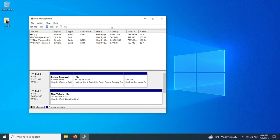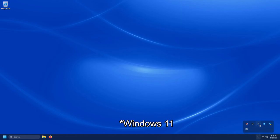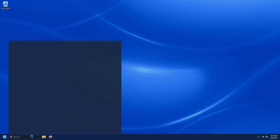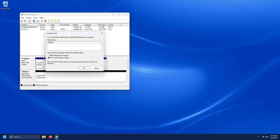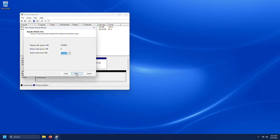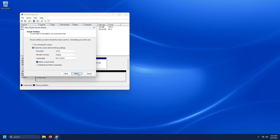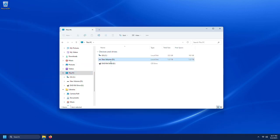The procedure for Windows 11 is very similar — in fact it might be exactly the same, but we'll do it anyway. Drive is spun up, we can see the dock in device manager, same situation as Windows 10. Search for disk management, same deal — it wants to initialize a disk. Say yes, it makes a basic disk, right-click, New Simple Volume, click through the wizard same as before, and there it is — online and ready to roll, ready to accept data or do anything you might ever want to do with it.